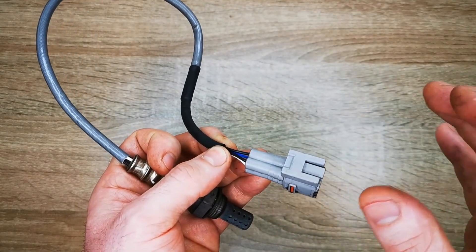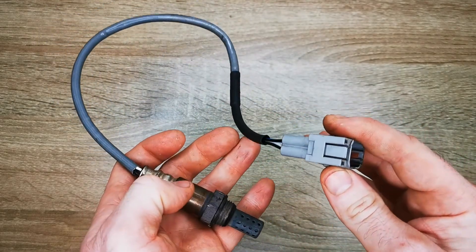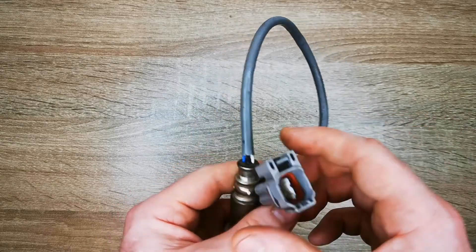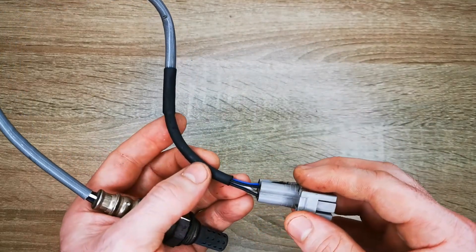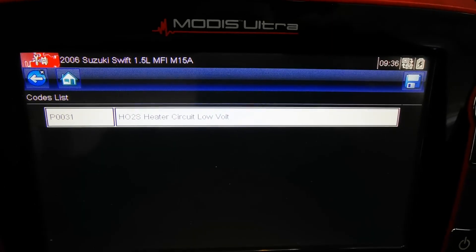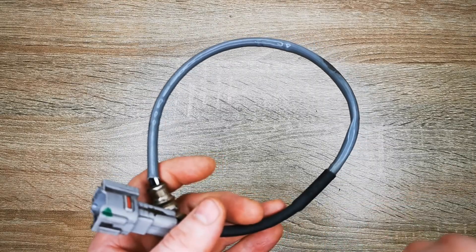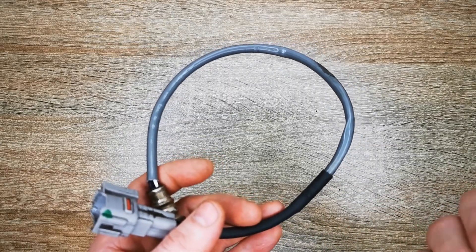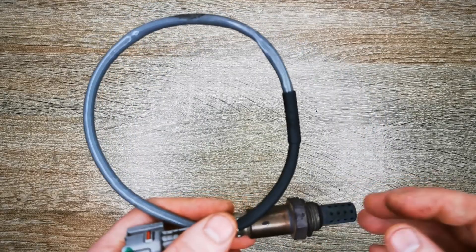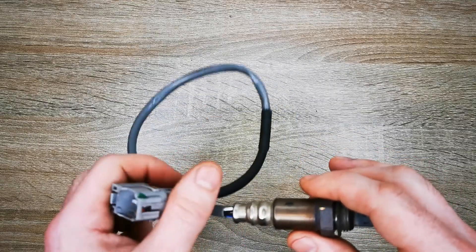Because the fault code is on the heater side, the signal and the low reference do not need testing, since P0031 was the only fault code stored on the ECU at the time. If there were other fault codes you may have to do further testing. There are many other related heater circuit fault codes: P0030, P0031, P0036, P0037, P0038, P0042, P0043, P0044, P0050, P0051, and P0052. If you have one of those, the testing information in this video will be the same.